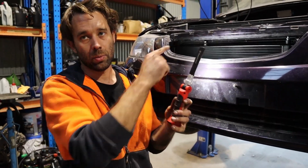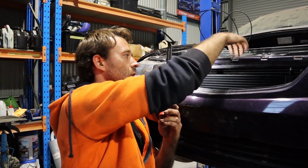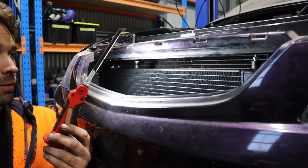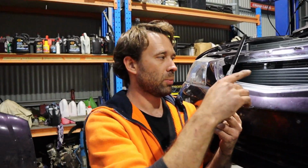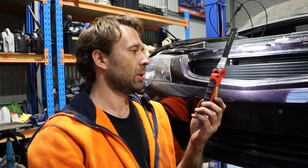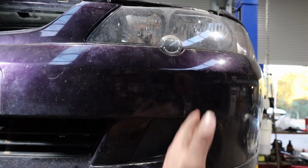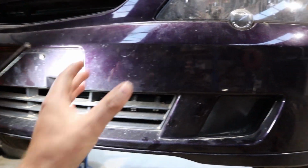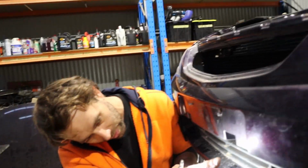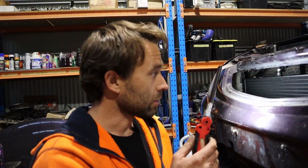The reason we had to do that is because we're putting in the transcooler and oil cooler, and they have to go between the heat exchanger and the condenser. We really want the exchanger at the very front. So it was easier to put them there than to move them under the tray and stuff. It's a little bit of mucking around, but it will work really well. And that pump's far enough over that we can still remove this and still build our little intake up into our airbox and everything. So everything will still fit the way we expected and wanted it to work. And the pump's still nice and low, so it's still gravity fed. It's not going to suffer from too much suction or anything like that.